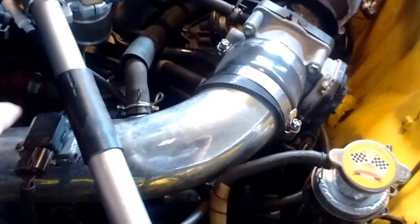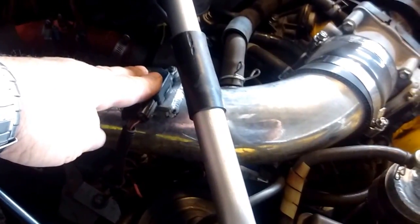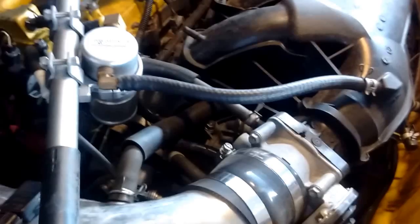It's important to note that this is metered air. The MAF — Mass Airflow Sensor — is positioned in front of this breather hose. The reason for this is that the air sucked through here ends up eventually in the intake, and therefore it must be accounted for in fueling.